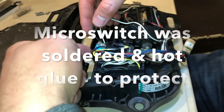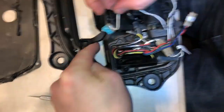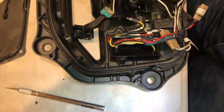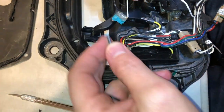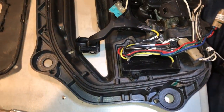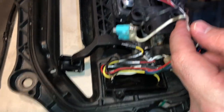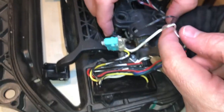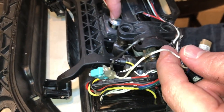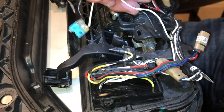We're just going to take this micro switch and put it right back up into that spot there. You've got the screw down here and then the stem that goes there — here's the stem, there's the screw, and then you've got a metal screw right here. Now, in order to get down up inside there and get the hex nut on there, I had to basically tear apart this assembly here — the motor assembly — pull that off so I can loosen up this switch and pull that whole thing back to give me a little more room.